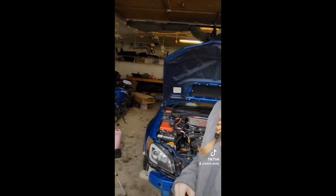I find it easier to wrap with the panel still on the car until I get to the very last stage where I have to tuck, and then I take them off. So the fender is actually going to stay bolted onto the car, and then I take it off after to tuck around the edges — it makes it stay a lot better. I do need to take the headlight out for that, so I'm going to do that now.